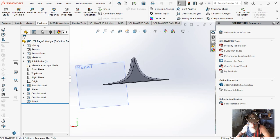So Stage 1 is 3/4 of an inch taller. Well, when your VRP plates are welded in place, it restricts the airflow between the VRP and the wedge itself, creating more velocity at a lower RPM. So that's why below 3,000 RPM it makes great torque.